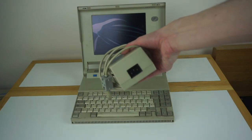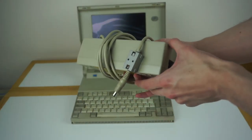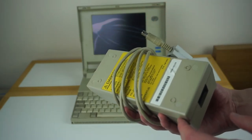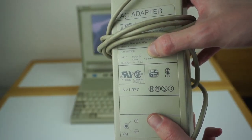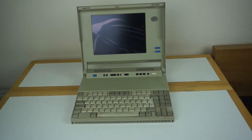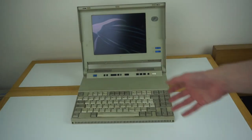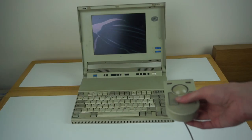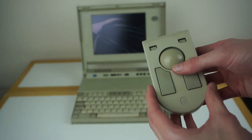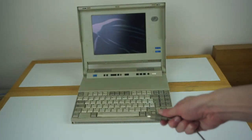So as you can see we get the massive power brick. It's light but it's huge — compared to my hand it's pretty large. It has a big IEC connector, and you can see the ratings on the top: 2.7 amp, 15 volts. You'll notice there's no trackpoint, touchpad, or trackball on the laptop itself — there's no built-in pointing device. So what you get is a trackball: a trackball on top with two buttons, and then two more buttons, with a standard PS2 connection to the machine.